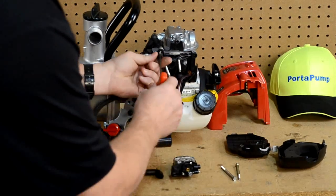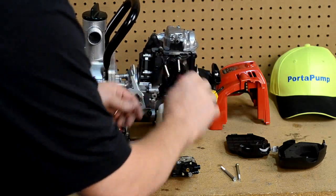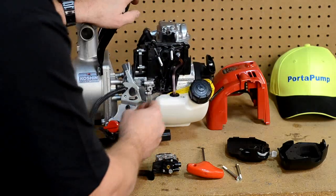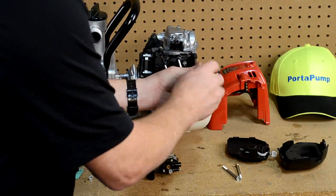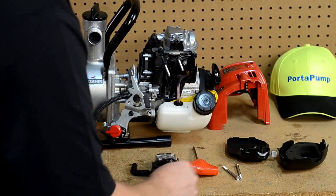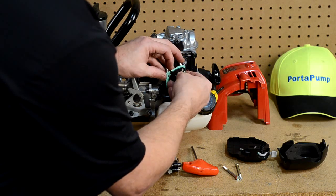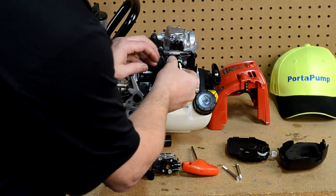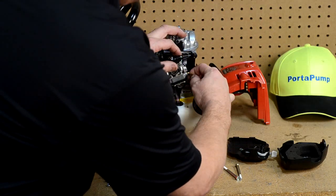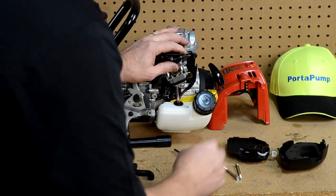You will want to secure it with the three screws that were in there originally. Once again I want to say we are not modifying the carburation system on this at all, because we run dual fuel systems on this and you will be able to go back to gasoline and run gasoline any time you want to. But of course we prefer you to run good clean LP vapor gas. The carburation goes back on just like it came off and we hook up all the fuel lines just like they are supposed to be originally from the factory, with no modifications.